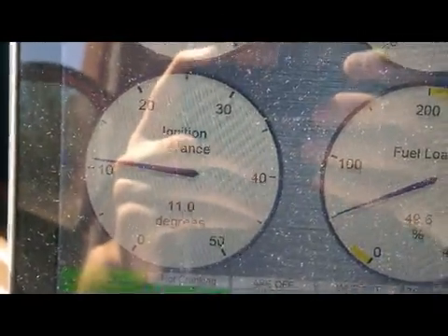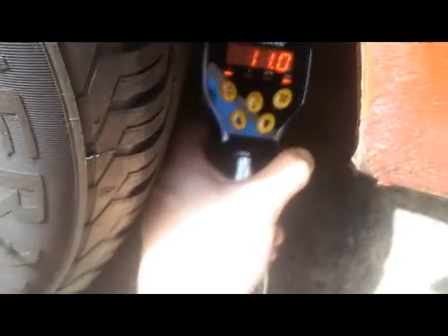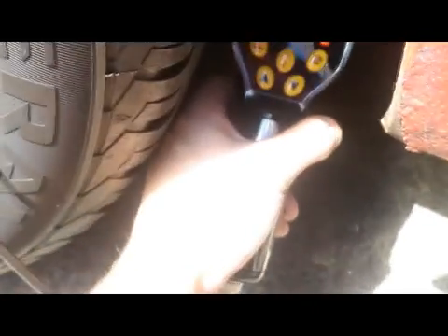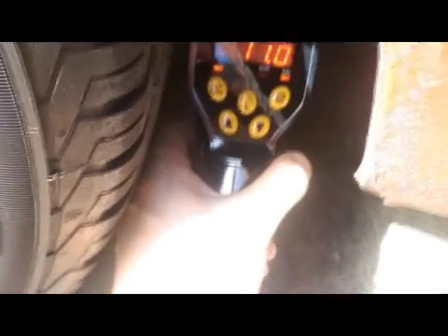When I go back, this is my other gauge cluster — let's go to the main dashboard. It says we're pulling exactly 11 degrees of timing. You don't want this to be walking around because when you set the timing, you want to make sure that it's right on the money. I have this set to 11 degrees of advance, and we're going to look at that mark on the flywheel and see if it's where it should be — it should be in the TDC window. I apologize if you can't see the mark. I'm going to try my best; this is the first time I've actually done it.